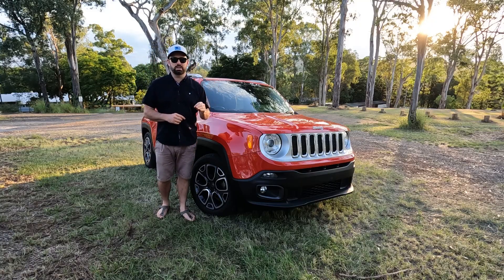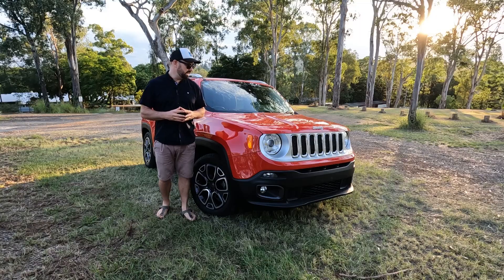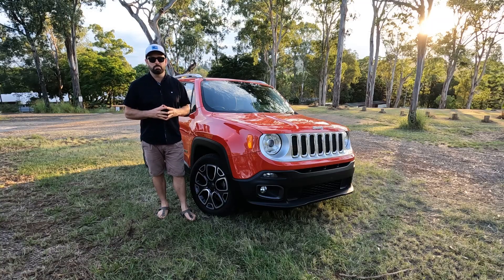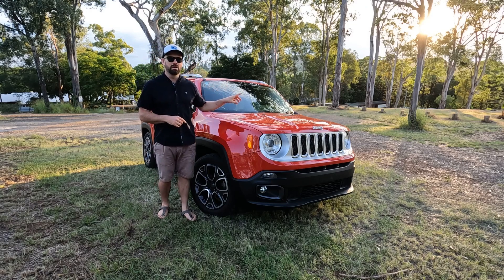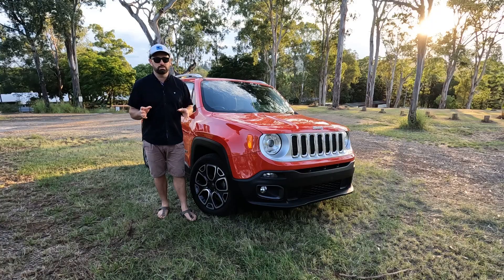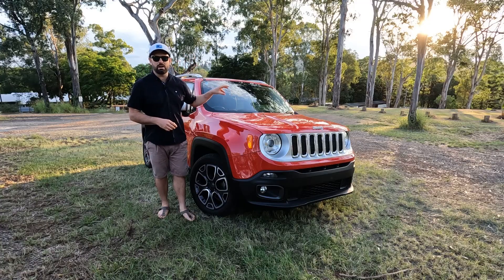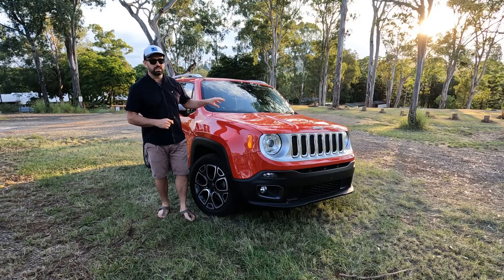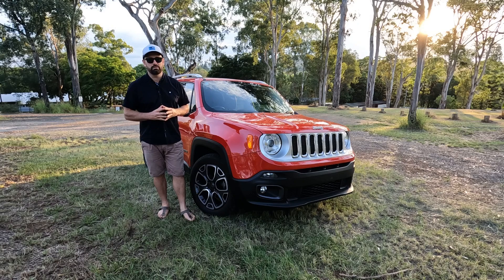The car's running really well. The fuel economy — miles per gallon or litres per 100 kilometres depending on where you are — is exactly as it should be for this car, and it's performing as it should. It's certainly not turned it into a race car; it's kept the performance about the same as before. A couple of people have asked would I recommend doing just the rotating assembly rather than a complete turbo replacement, including the hot and cold side, if money wasn't an option? I would say no — if money wasn't an option I'd recommend the OEM Garrett part replacing the whole set.